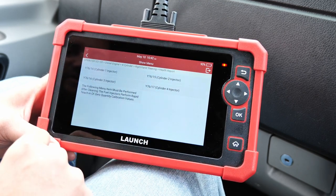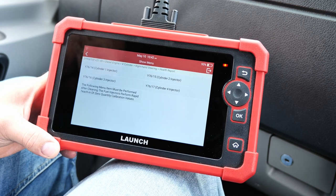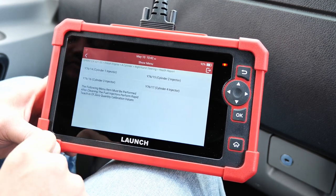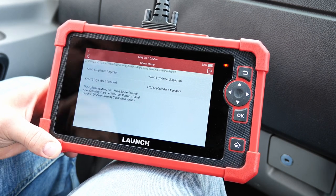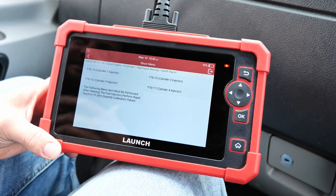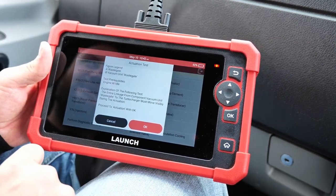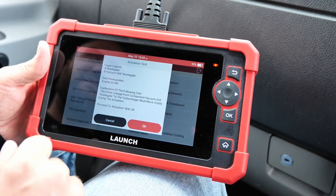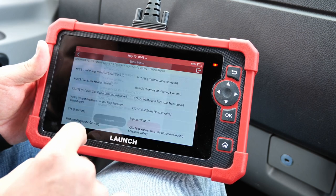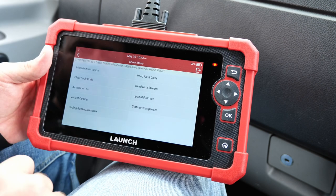For injectors, you can change the values — and this actually helped me resolve my last problem. I had issues with the quantity injector control valve, and you do have to reset the trim values of the injectors after swapping the quantity control valve. This helped me do the initialization of the new component. You can also see the wastegate — it's a bi-turbo engine with vacuum-controlled flaps, and you can check them individually. I've never tested a diagnostic tool that can do this kind of thing.